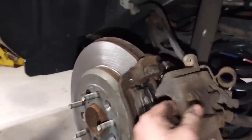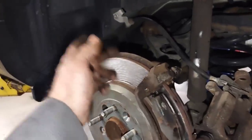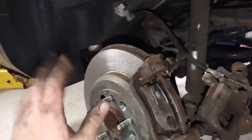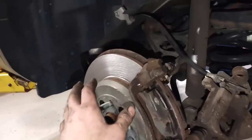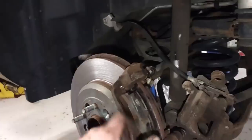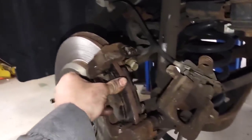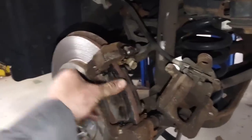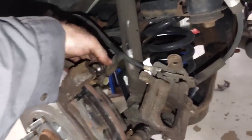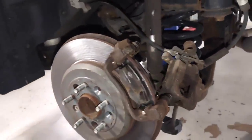I've got the rotor cut. When I'm reusing old brakes I actually add this texture to the rotor - it's my way of doing it when I'm using somebody else's old stuff. It really helps get these to seat in better. Pads freed up, cleaned the surface, brushed over with a piece of 180 grit, and then slide pins moving. Get everything put back together.